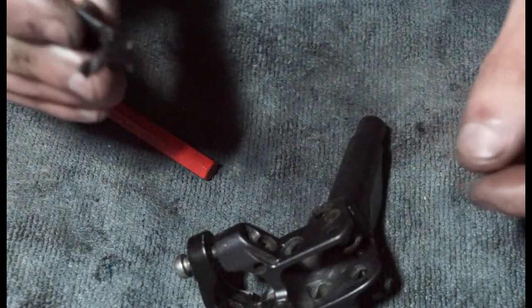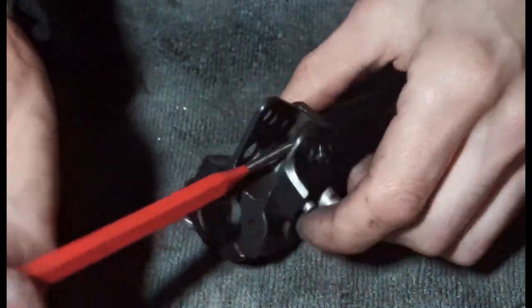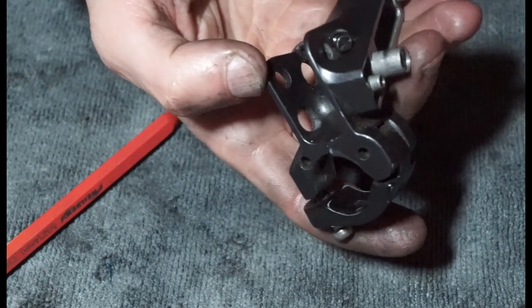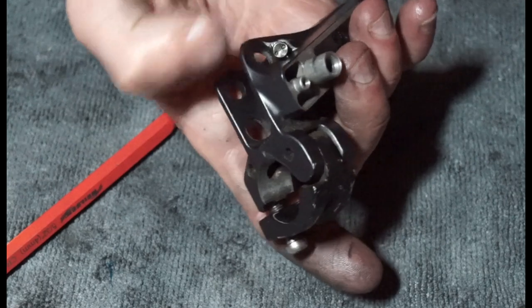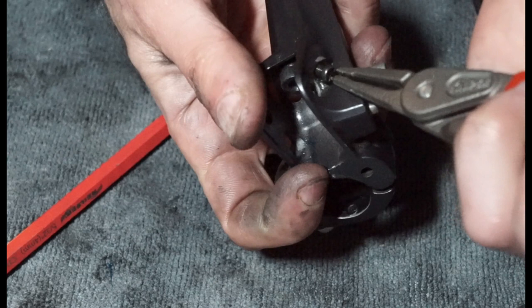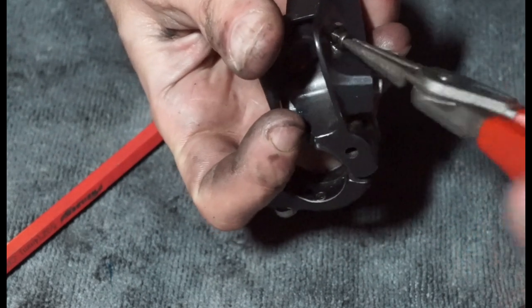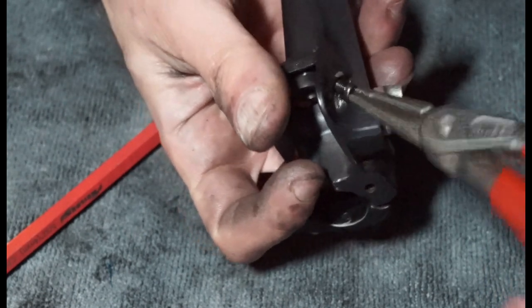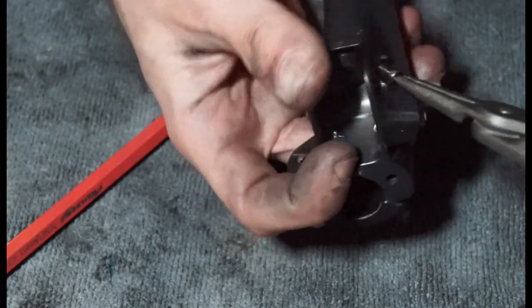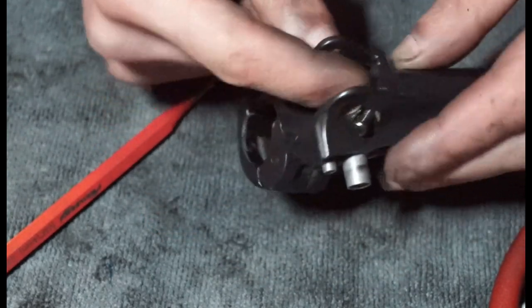So hopefully that's going to hold a little bit better, make my life a little bit easier. So we're going to use a prodder to push on the piston. Oh, the other thing is, before we do all this, you want to back this screw out because it will just make your life easier. This little three stroke screw with a weird end on it. I don't know what the size is for the thread, it might be an M4. So we just back that out, otherwise it's protruding through and getting in the way. And then you can see under there, there's no screw sticking out.